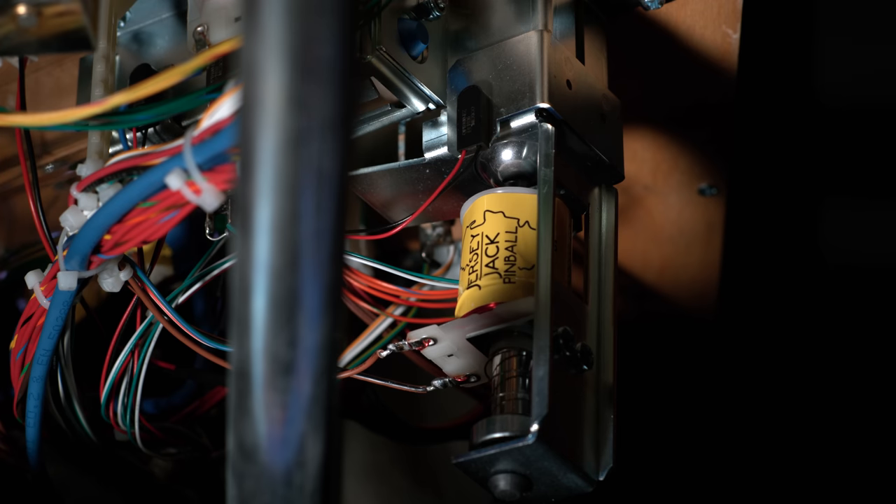Now let's move on to the tilt bob — it sits inside this machine on the left. It's swinging loosely and it's got a ring surrounding it. When you nudge the machine, give it a little tilt to try to save the ball, it gives a warning because it detects that the tilt bob has hit the ring. It's a big part of the game to smack the machine around, but if the bob hits the ring three times you get a tilt — you'll lose your current ball and lose your bonus. Finally we have the knocker, which sits in the back box — it's the thing you hear when you get a high score or roll over the special. It's just a solenoid with a plastic tip rod that thumps a piece of metal. Incredibly simple.